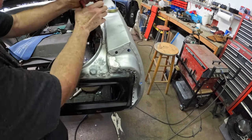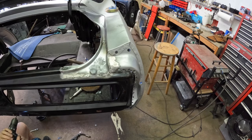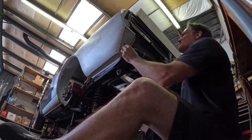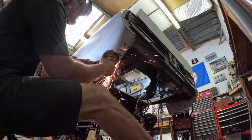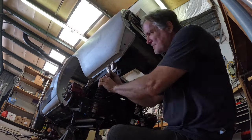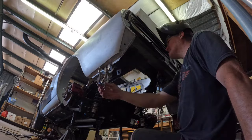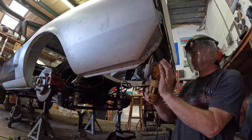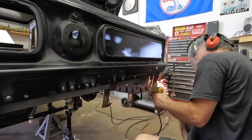I'm tapping the upper section down and folding it over. Turning my attention to the rear valance panel and getting that welded in place. Now I'm starting to focus on the lower quarter panels and the back section of the quarter panel. There's a lip from the inside tail pan that comes down — it's always longer than the quarter panel so you need to trim that. The outside quarter panel has a small groove where it folds over slightly, and I'm trying to get that same groove on the inside of the tail pan so I can weld that.